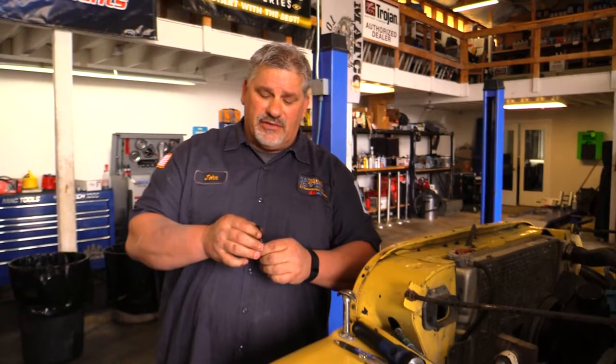The reason why it's so important to change that spark plug is because you got winter coming on. Colder weather means that it'll go into a cold start mode, which actually, if your spark plugs are not running efficiently, giving out enough spark, it means that you're wasting fuel. Along with that, when the cold air is coming into the intake, not only does the cold air actually compress more, but if you're not getting a clean spark, you're getting too much air-fuel ratio to the spark for it to be efficient. So the importance of changing out your spark plugs to making sure that your ratio is correct, making sure your spark plug is at the right heat range is very important, especially in the winter time. Because as you all know, cold air compresses, hot air expands.